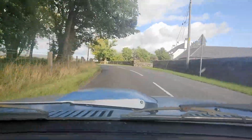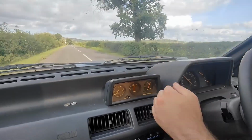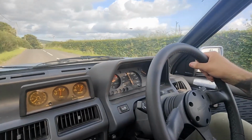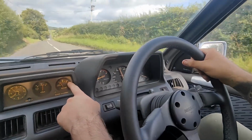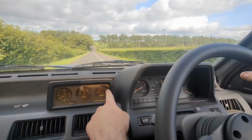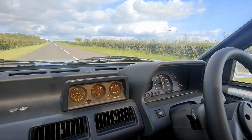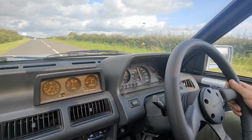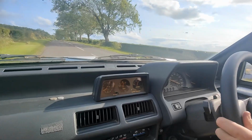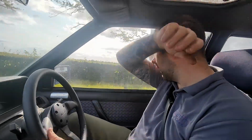So just try to see the gauge. Michelle, can you come back? Just hang. Supercharger light is off, then it's engaging there. And then when I get to 3000 revs, the boost is going through the roof as well, Michelle, if you look at the gauge. Yep, I've got all the gauges. It seems like the boost is topping off when I get to 3000 revs, and it's just kind of nosediving on me. And if you just tick over here, just gentle without asking for the boost, it seems to be pretty not bad. But there's an issue there somewhere. Now, I do want to emphasise that this is only just a short kind of pilot test, nothing more.